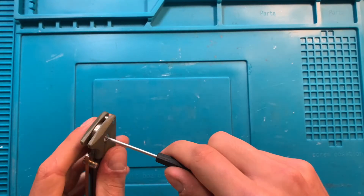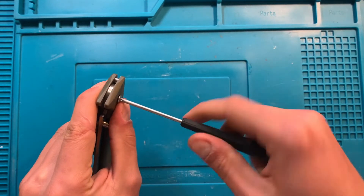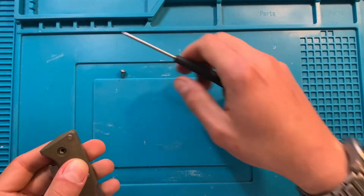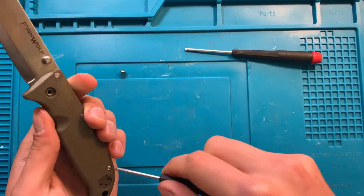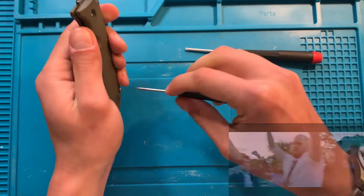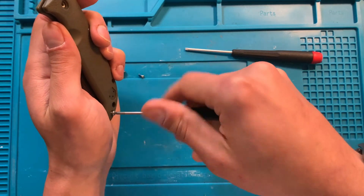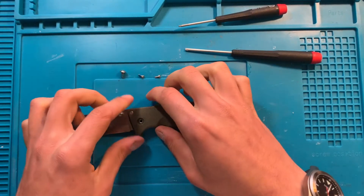And we are going to take a look inside. We're going to start by taking down the pivot. It is always nice to see a subtle yet present use of Loctite — that's what the blue striping there is. The pivot here is a T10. The body screws are T6, and they are all well and perfectly adequately Loctited, which I can certainly appreciate.